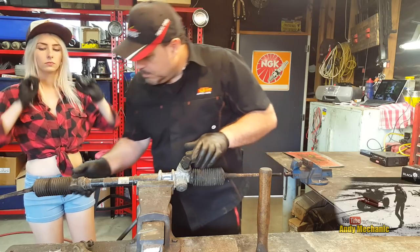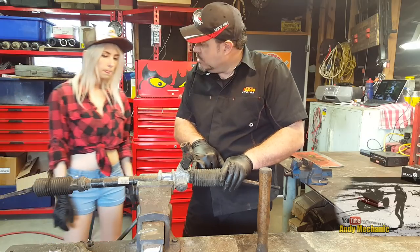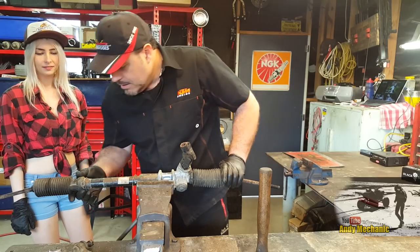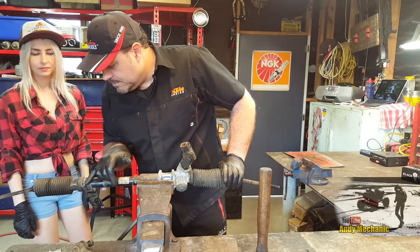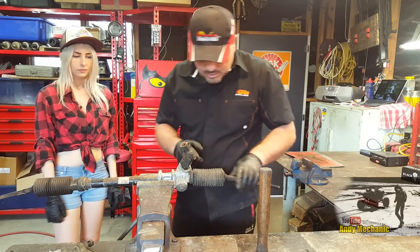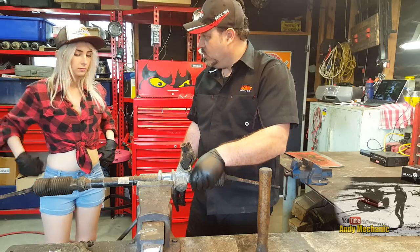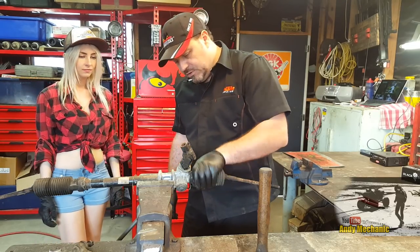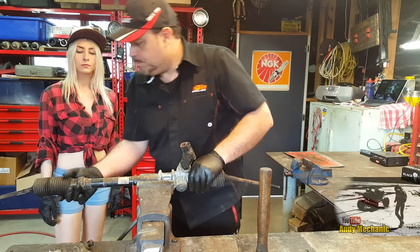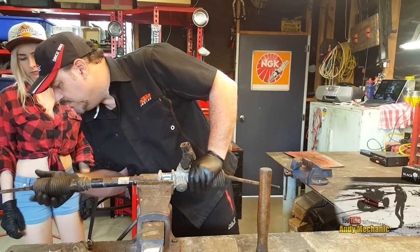These look pretty old. Now, at some point, this one's been replaced, because see, it's got a cable tie on there. It shouldn't have a cable tie. That's bad. Bad mechanic. It should have these wiry clips like this, or similar. It should be a metal kind of fastener that holds it in place. Certainly not a cable tie. And I've seen cable ties used on CV joints as well, on boots, which is really bad. You see that one moves around. It's quite loose, and water can get in and stuff. That one's nice and tight because I've used a proper clip. And sometimes there's a clip at this end as well, but that one doesn't seem to have that.